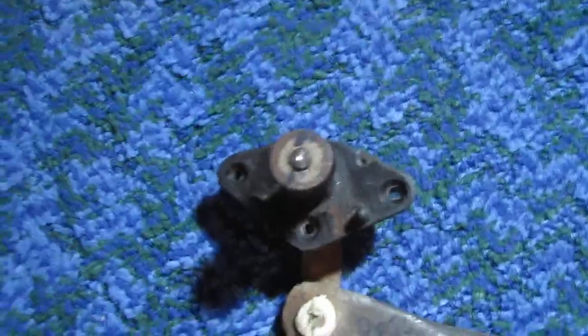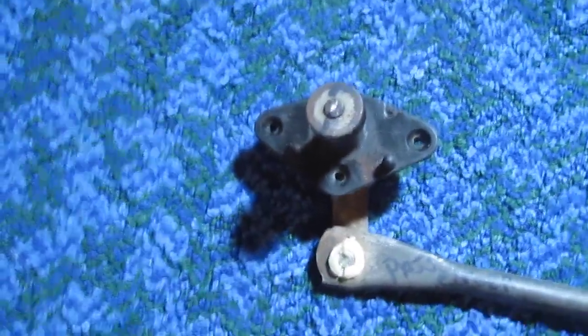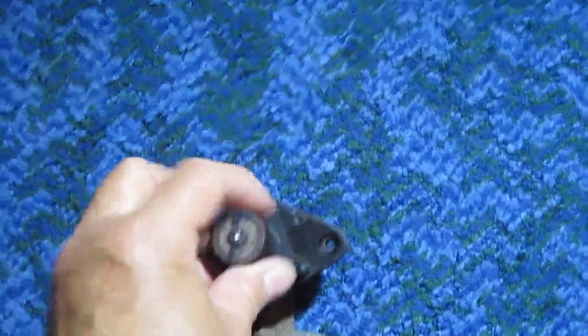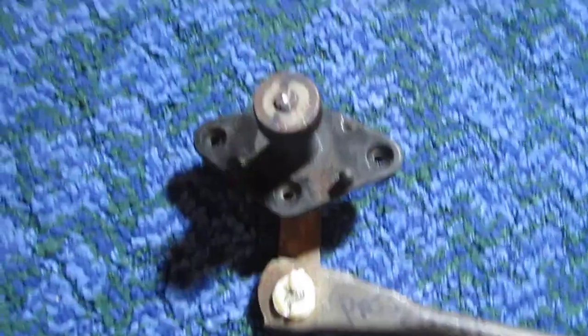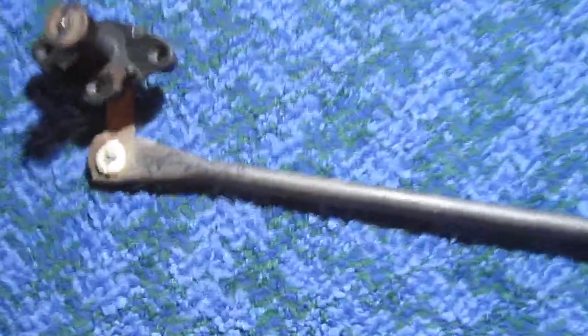So what I ended up doing is the wiper arm is aluminum. I drilled into it in the middle, about maybe a 3/16 drill, enough so I could get WD-40 and penetrating oil down into that hole, and where it would work its way to the splines. So eventually I got it out, and I got it out with my hand. And when I install, I'm gonna put white lithium grease on both splines. Of course, clean them with a wire brush. So that's it.